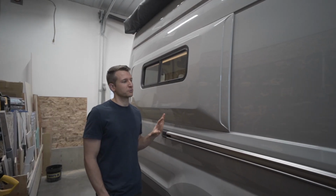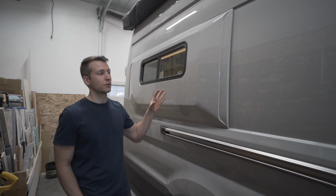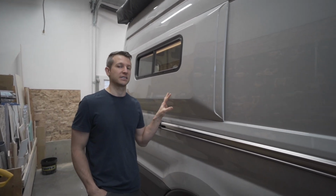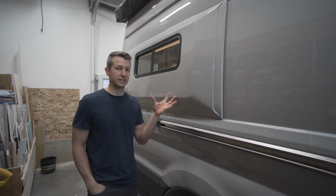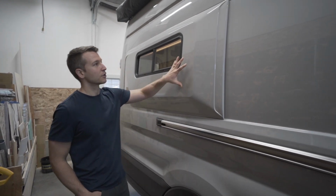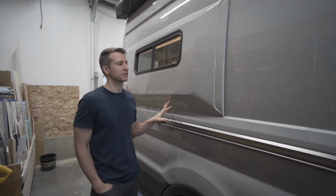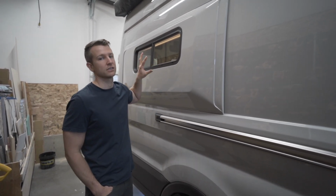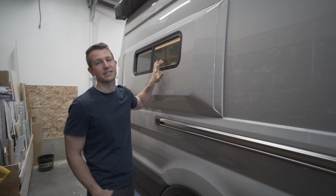After much research, we chose the capsules because they add the most width to the Ford Transit, an extra 6 inches, going from 77 to 83 inches interior dimensions total. We like the contour of the capsule compared to other options, and we like that it comes with the bunk window already cut out, so you just install that CRL half slider bunk window.